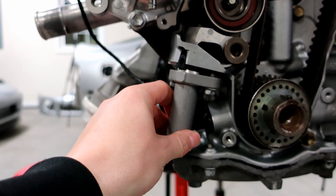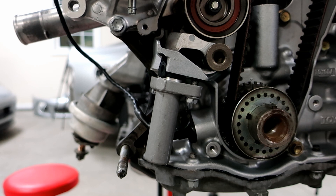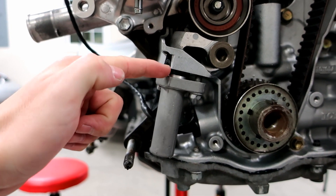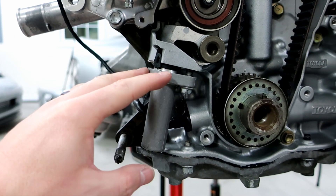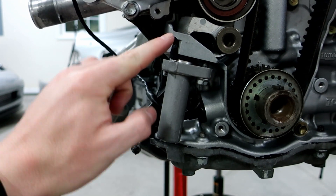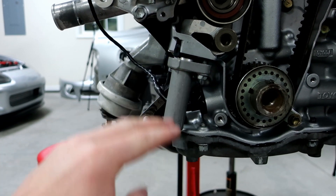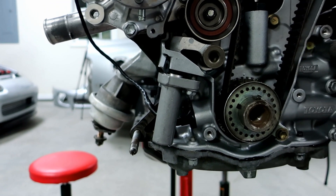The last thing you need to do is put the actual tensioners on. There should be a pin inside of here that releases tension off of this. Somehow the pin is missing on this brand new piece — it even had a giant tag saying 'don't remove the pin until you've tightened it up,' but the pin's not there. Unfortunately I'm going to have to do this the way I don't like to, but these bolts do reach. I'm going to pull this up slowly — it builds up tension and puts tension on the pulley. I'll slowly draw these up until it puts enough tension to fully hold the belt.